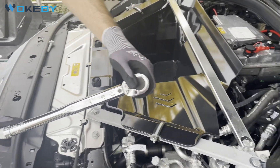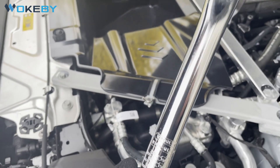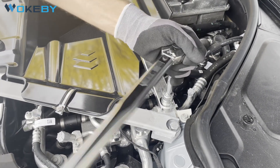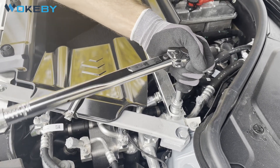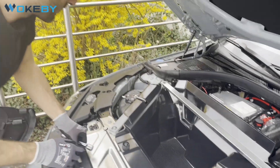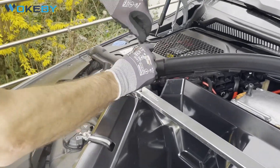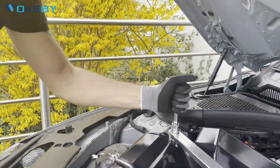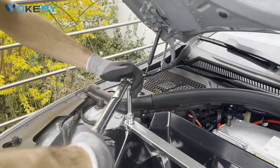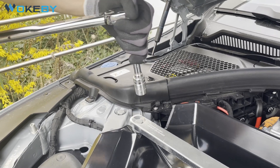We cut out a little bit of the screwing. Now we will tighten the screw with 17 newton meters and give it two clicks as usual. We do the same procedure on the other side — holding the wheel — and once again we tighten the screw: 17 newton meters, two clicks.